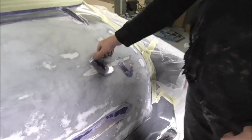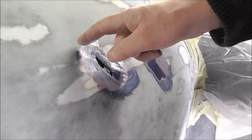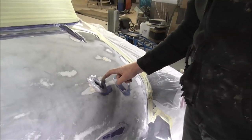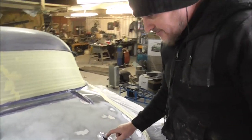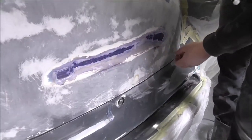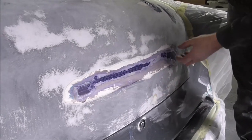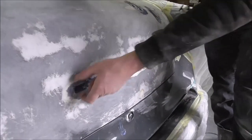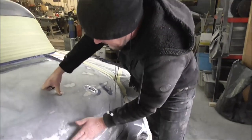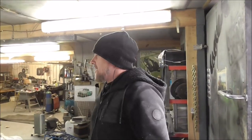There's a small crack in the body there - that's part of the modification, so that's not down to rust - but we can glass that and make it a lot stronger. Also here, I think it was simple flexing in the bottom of the boot. We've ground it all back to the steel - there's a lot of filler on this - but it will all be filled with fibreglass to get it smooth. With anything custom where things are smoothed out, there is always going to be a lot of filler.